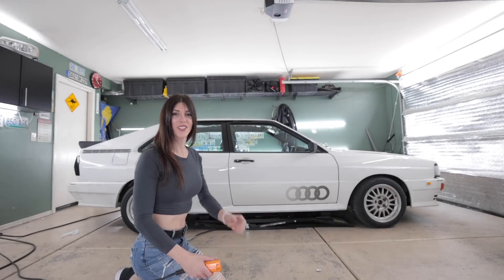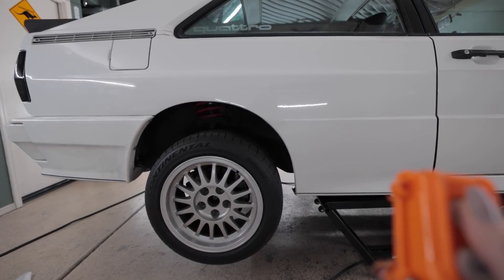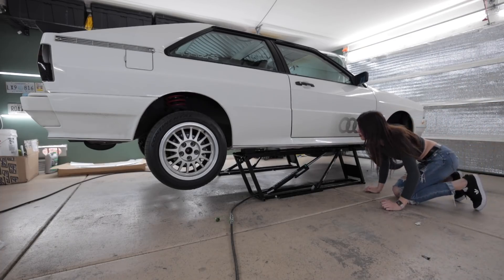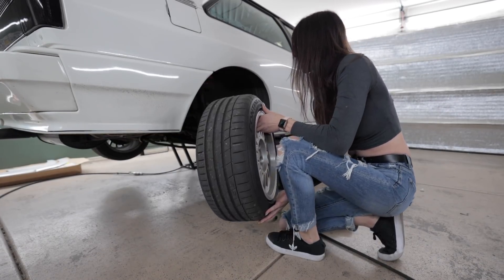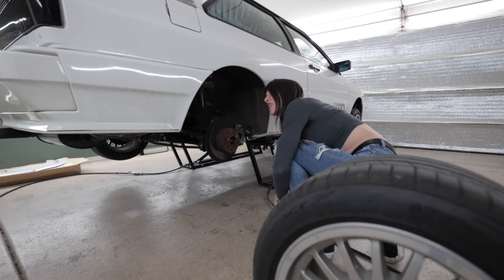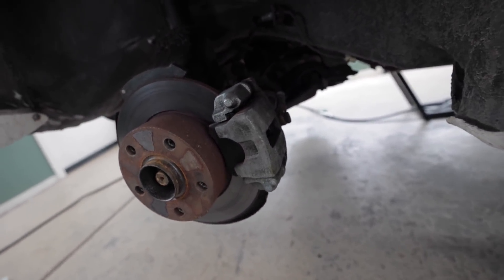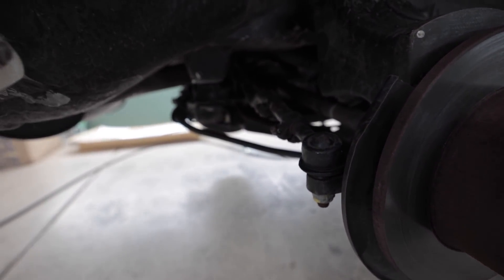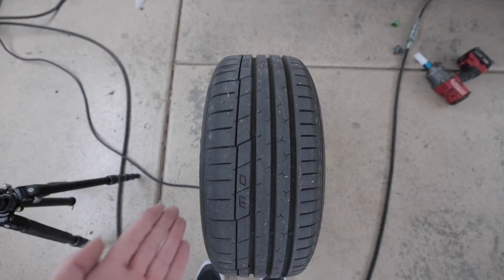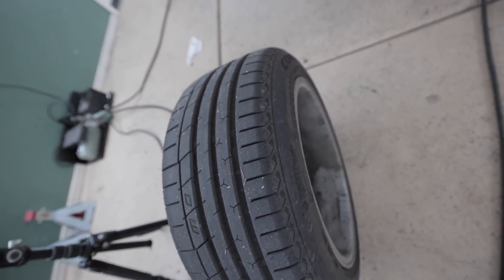This feels so weird — it's been so long since I did anything in this garage. I need to clean under this car so bad, I need a dry ice blaster to do it correctly. But wow, this thing is actually super clean under here — it's dirty like dirt, but the structure is really solid. It's got lowering springs on it too. The brake rotors have rust on the hats but everything else just needs to be cleaned. The tires are way too stretched on an eight-inch wide wheel — I'm not a fan of stretch tires on a car like this.